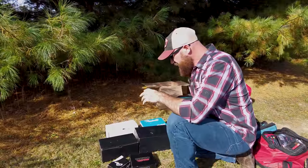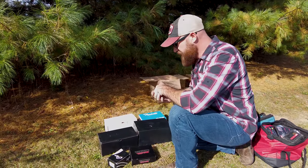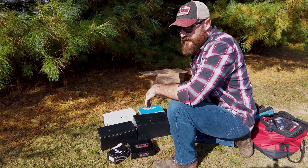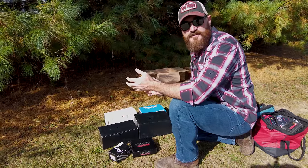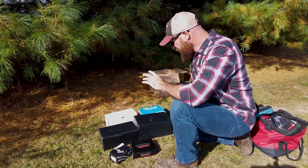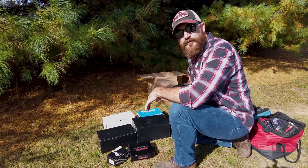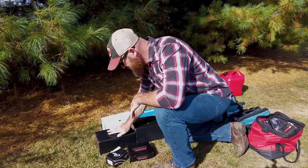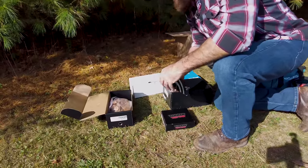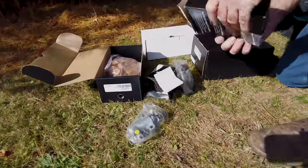So, being it's an older truck, when you look up part numbers and the different types of parts that are in them, there's multiple parts it could have had. I didn't have the truck near me, so I didn't know whether it was a three-bolt mount or a two-bolt mount master cylinder. The same with the slave cylinders. I didn't know how big of a bore they were. So I did what any guy would do that didn't want to drive 6 hours for nothing, and I ordered one of each. So we have multiple master cylinders, and multiple slave cylinders for the clutch. Now it's just going to be figuring out which one fits, and hopefully there wasn't a fourth or fifth one that I didn't know about.